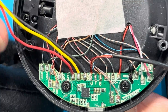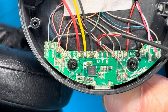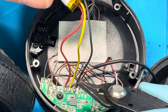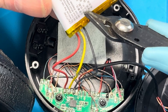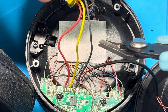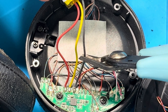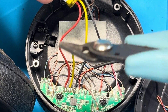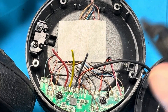At this point we run into a problem if we don't have professional equipment like a soldering iron to remove the wires from the board. There's no simple connector to unplug - the wires are soldered onto the board. If you don't have a soldering iron, what I suggest is you just cut the wires relatively close to the battery. You don't need the battery anymore, so it doesn't matter how short you cut those wires. Cut them one by one - not at the same time - in order to avoid creating a short, which could be dangerous.